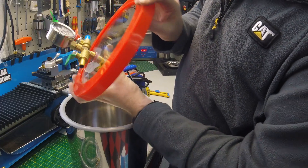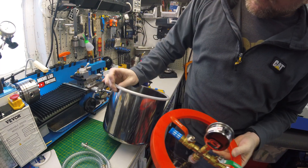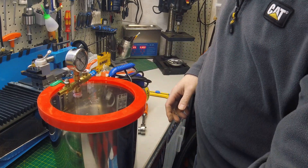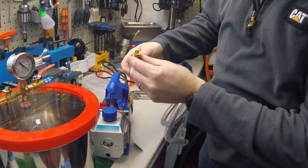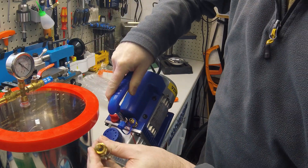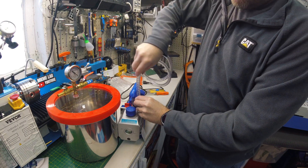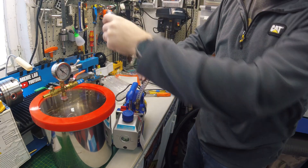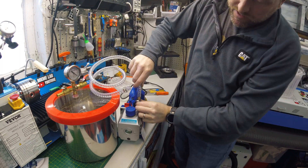The seals are just starting to donut a little bit, bulge out at the sides and not stay straight anymore - they just become slightly rounded. That's when you can tell you've got a seal with just a little bit of compression on it, and ideally not too much. Our line's going to go down on there. Note how that's a conical shape and conical shape in the bottom there - you don't need to use Teflon tape on that. The seal is made on the conical flare shapes, and you don't need Teflon tape. You can use it, but that isn't where your seal is. I see people online using Teflon tape all the time and that's incorrect - it's not needed.